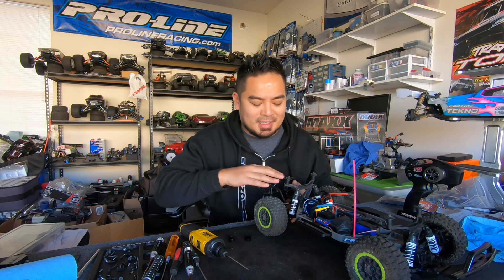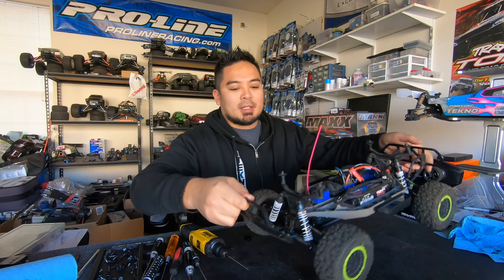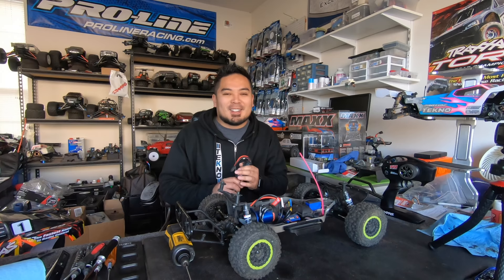I plopped the car on the ground and it just slammed down — chassis slap — I need to adjust the ride height. The way you adjust the ride height is with these little clips that came with your car if you bought it brand new. They just clip around the shock body. You pull the spring down like this and then snap them on there, and basically it compresses your spring a little bit more so it raises your ride height. Battery's all charged up, we're running out of daylight a little bit so I'm gonna try to hurry.